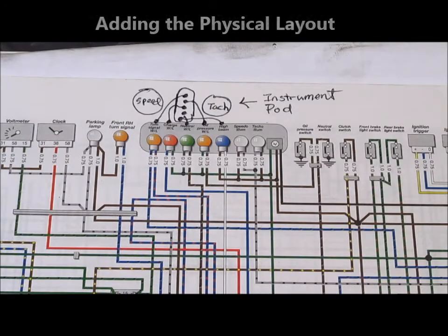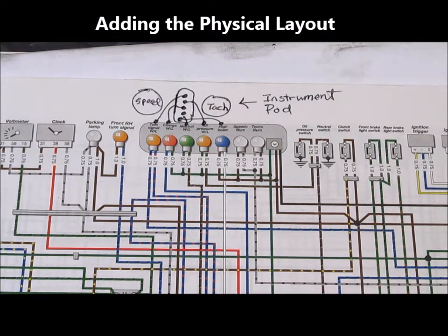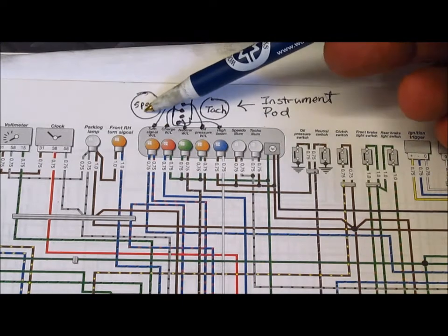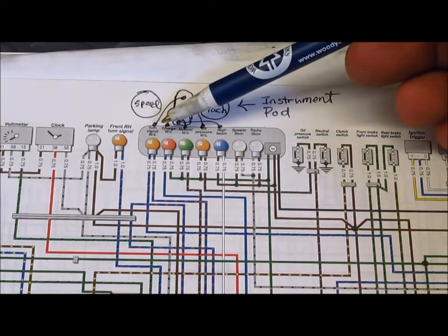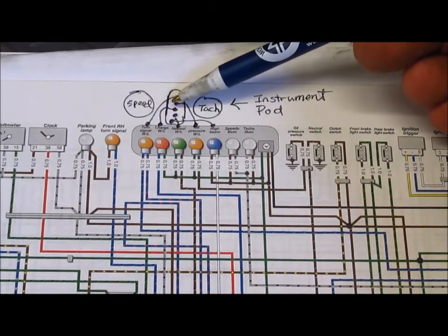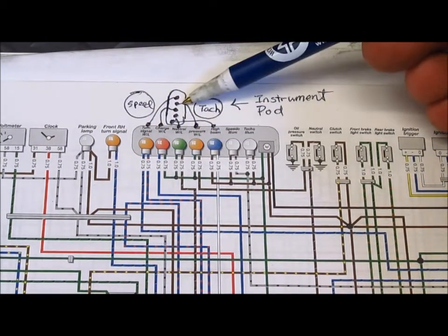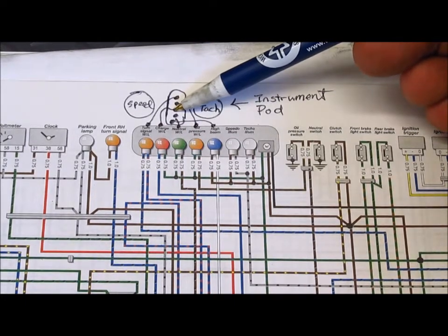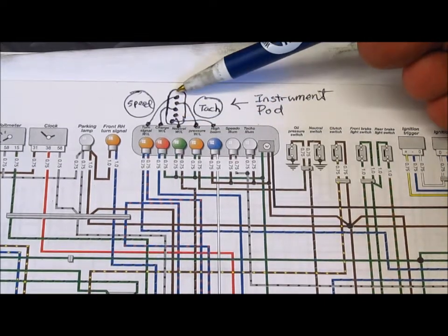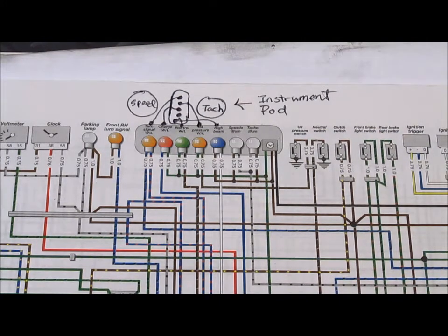At the top of the diagram is a set of light bulbs that are what you find in the instrument cluster. I've drawn a little schematic showing the instrument cluster with the speedometer and the tachometer, and for each of the bulbs shown on the wiring diagram I've shown where they are on the instrument cluster. For example, this is the turn signal which is the top bulb, this is oil pressure which is the second, this is the generator charging light which is the third, and the neutral light is number four. Doing little things like that help connect the real world with the kind of information you find on the wiring diagram.